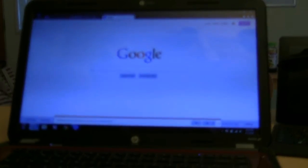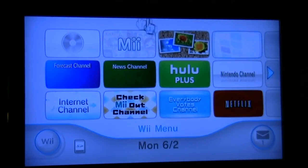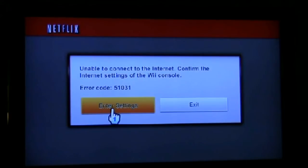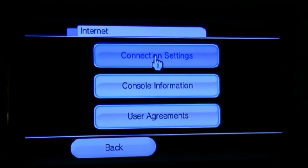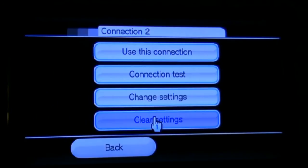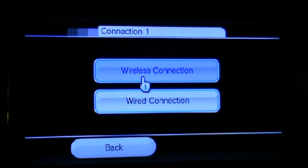We test by visiting the Google home page. Next comes Netflix. We use our Wii console for Netflix, so we start at the Wii menu. We click Start, and after a moment we get a message that tells us the service is unable to connect to the internet. We click Enter Settings, then Internet, then Connection Settings. For Connection Settings, click Wireless Connection — that's the settings from the old router. Click Clear Settings, and Yes to proceed.